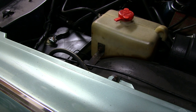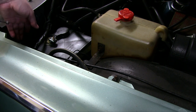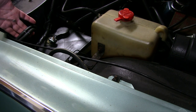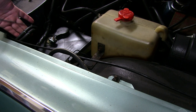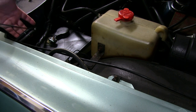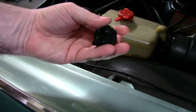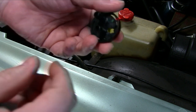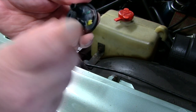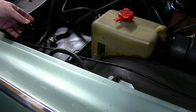We are up here in the left front, the driver's side of the car. You see the coolant overflow and the washer fluid bottle. You're going to want to dig down here — right up in this corner, it might be pushed down a little bit. There are two vacuum hoses and they will be connected together with this four-port valve. This is what they call the service valve. As you can see, it's marked where you're supposed to hook up the green and the yellow line to — it would be in-line in here like that.